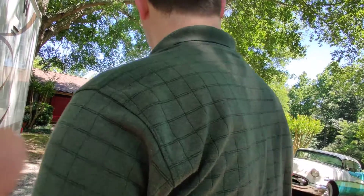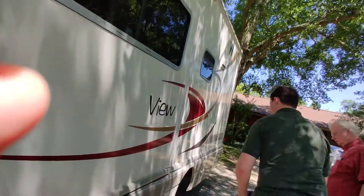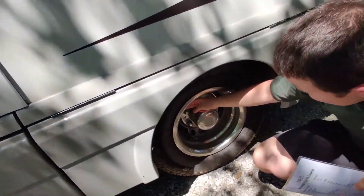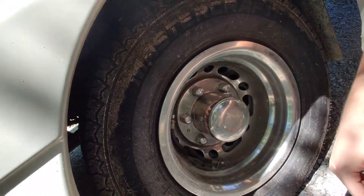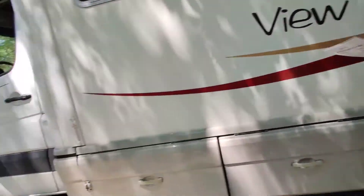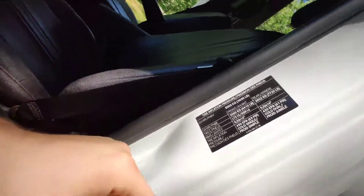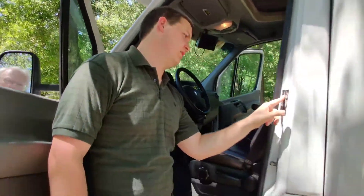For propane, this is a dual tank setup. If you want to fill up the tire pressure, there are two valve stems — the longer one is for the back inside tire. Make sure they're both the same. The tire pressure placard shows 63 PSI for the front and 61 PSI for the rear.